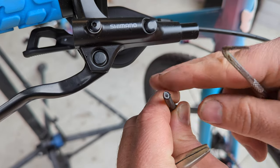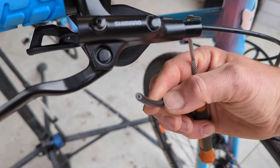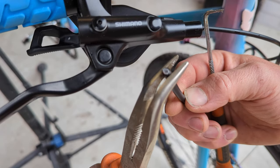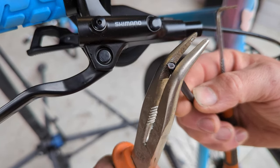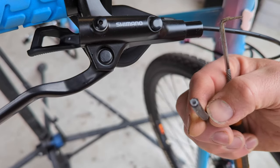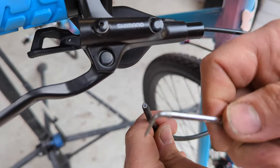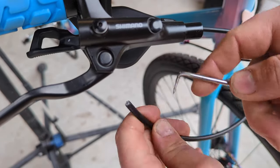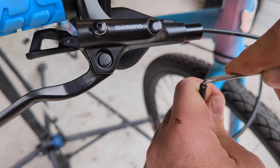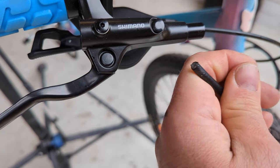After the cut, it's gone a bit out of round. So we're going to just get some pliers and squeeze it a little bit to round it up. Looking better. And then we're just going to get a little pick and chuck it in there, get all the crap off the end, and make sure it's nice and clean for that barb to go in.